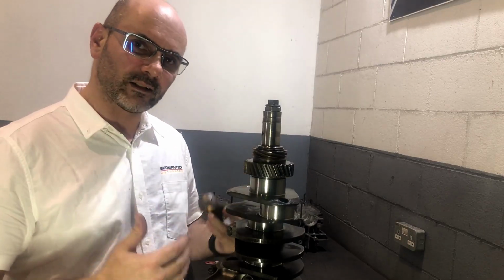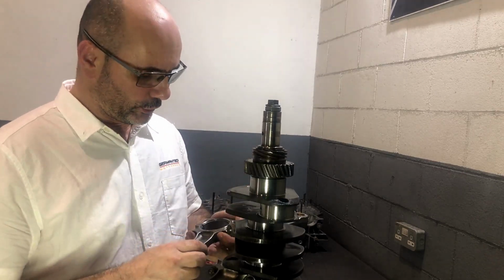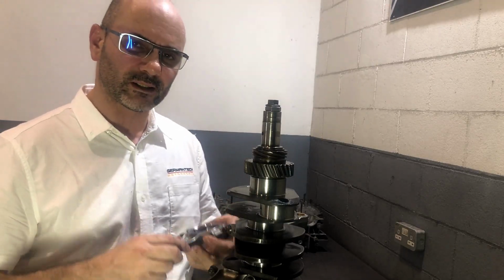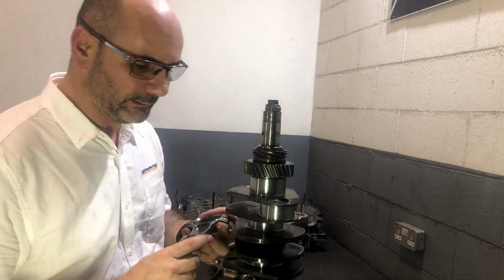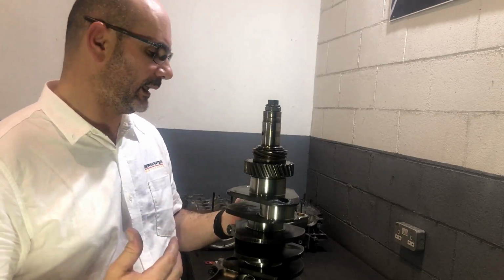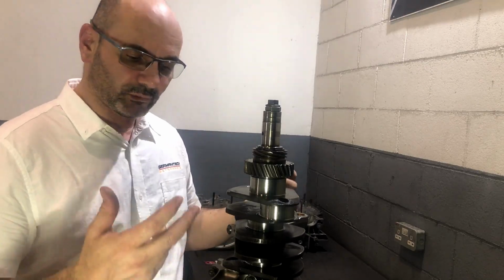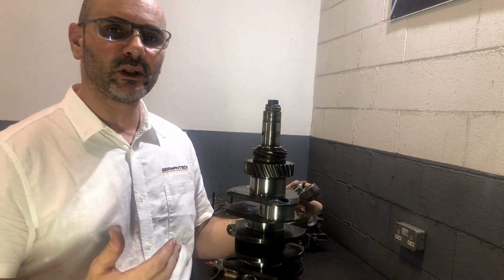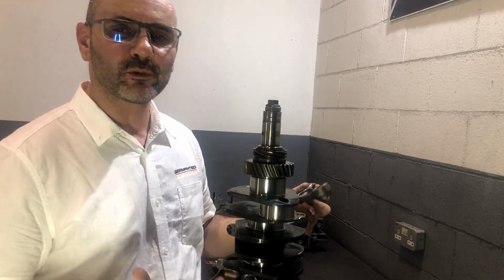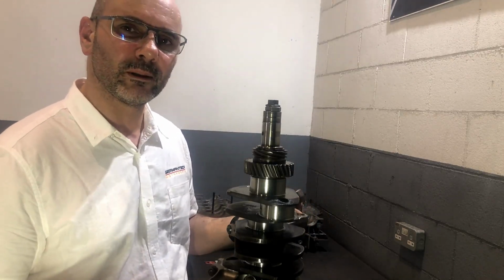So we decided in that case to replace all connecting rods, because it is very important to us that they all have the same weight. Now we are in a different weight group. In fact, we are slightly lighter than we were, by around 20 grams. But the connecting rods are now between 639 grams and 641 grams. So this is a range that's absolutely perfect.